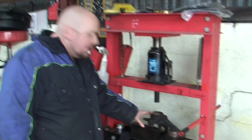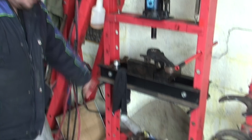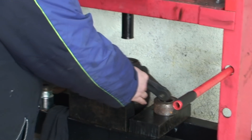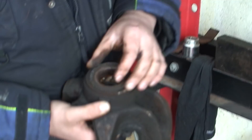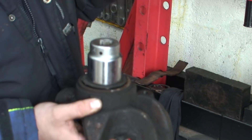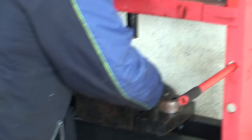Set this up as level as you can. When you do bearings, it's always best to keep all the old bearings because you get all the old shells and stuff. To try and push down on this with the balls like that can be very difficult, and if you push down on this ring it's just going to push it out. So we get an old piece of a bearing, shove it down, then get a socket - this one happens to be a 38 mil socket.